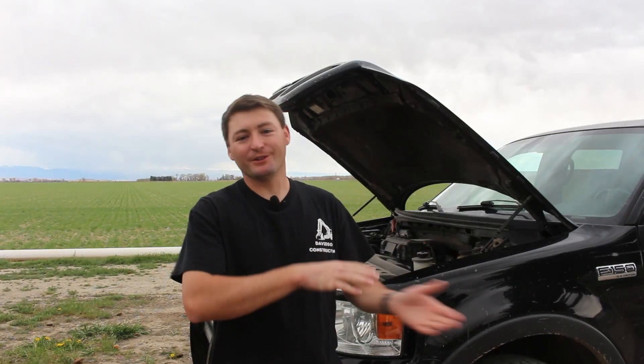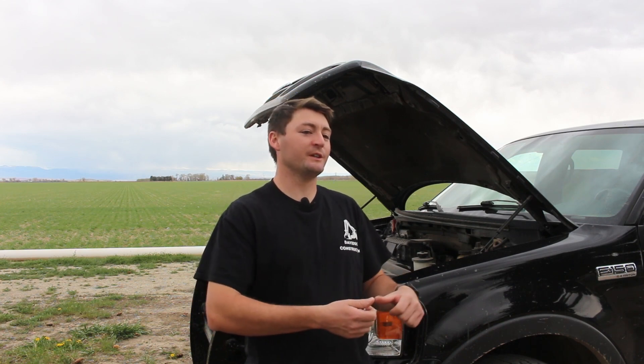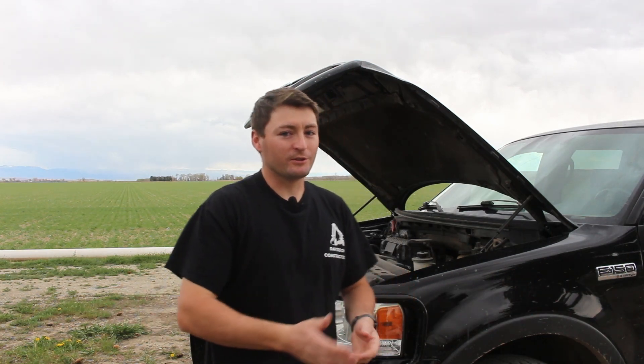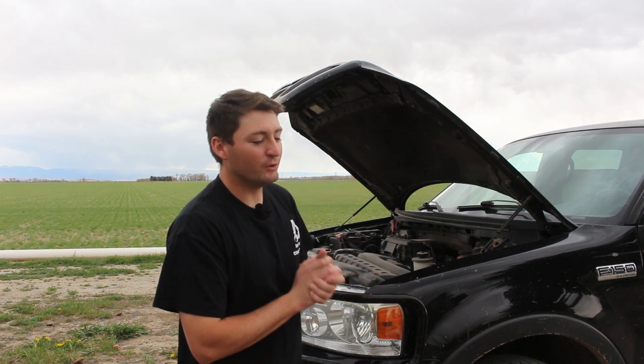I'm going to include a timestamp so you can jump right into the video. The first most common issue on these motors has to do with the ignition system. The two-valve variant had trouble with their spark plugs — Ford included too few threads on the heads, and those engines would eventually spit them out right and left, which is not good because you're down a cylinder while driving. So Ford, to fix the issue, added quite a few more threads and had a new redesigned spark plug. That seemed fine and dandy because these engines no longer spit the plugs out,